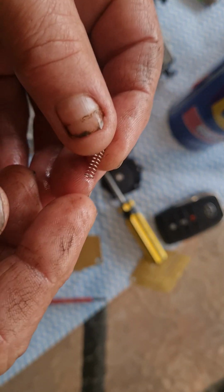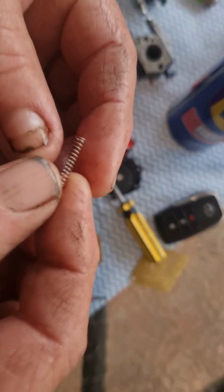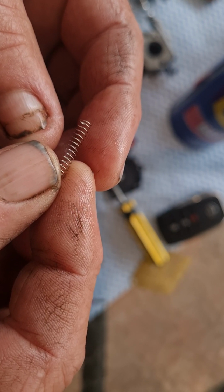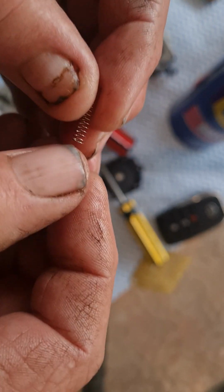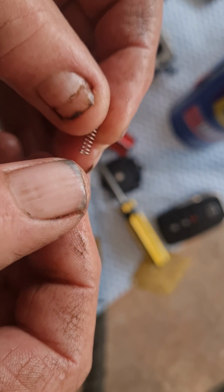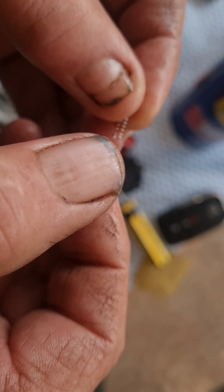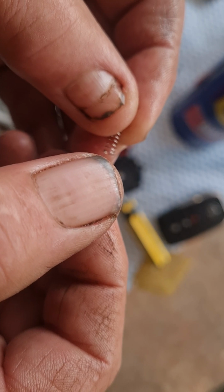Okay, now I'm not going to crop this spring. What I did with my WJ71 from my Rovan engine, it had the same PSI on the seat. It was way too high. I ended up clipping it. You can only do one coil at a time. Basically, I worked out to about 22 PSI on the seat, popping off completely, and dropping down to say 12. It was still on 12 PSI on the seat all day.